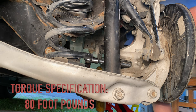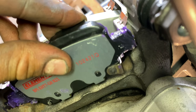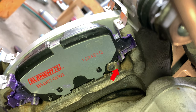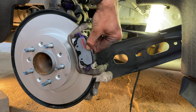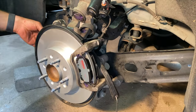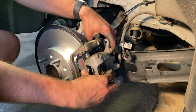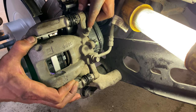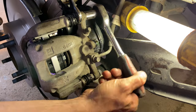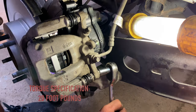You'll be pulling upwards with the wrench to tighten. Looking at the inside of the caliper mounting bracket, set the inner brake pad into the lubricated retention clip, taking note of the position of the wear indicator to the right. Set the outside brake pad into the lubricated retention clips. Remove the strap used to hold the brake caliper in place. Set the brake caliper into the caliper mounting bracket. Place the 13mm bolts into the upper and lower caliper slide pins. Tighten both with a 17mm open-ended wrench and a 13mm socket wrench. Torque these bolts to 20 foot-pounds.